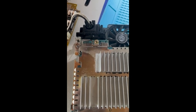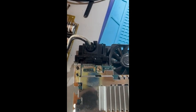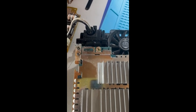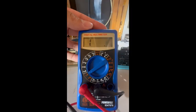I always forget this screw. In earlier steps, when you remove the screws attached to the power supply plug and the fan assembly, there is another screw under there that also secures the heatsink to the board that needs to be removed.